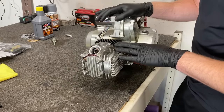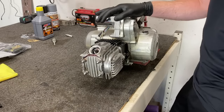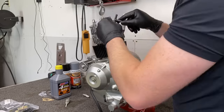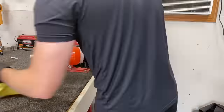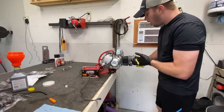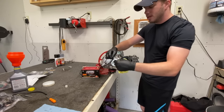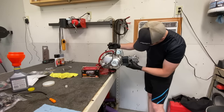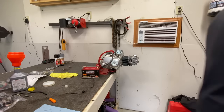This thing is coming together really, really smoothly. All I've got left to do is set these valves and get these covers on, and then we'll go ahead and recheck compression. I got it all set up — we're going to go ahead and recheck for compression. Let's go ahead and turn the starter over, make sure it sounds good. Sounds healthy. Let's do the thumb trick — go ahead and put a thumb on and see if it blows a thumb off. We're going to have compression.